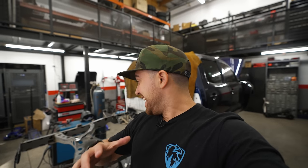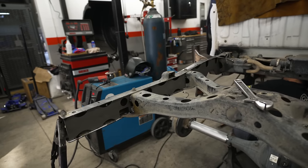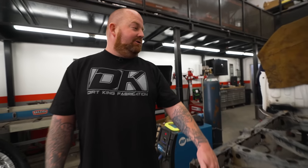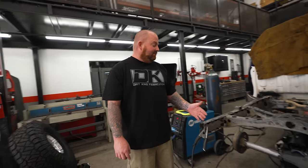While Ian is working on the front of the truck, Taylor's in the back installing the frame plates so Dustin can send it without fearing his chassis is going to bend. From the factory the Tacoma frame is just a C-channel frame. What we do is a full frame plate kit that makes it a boxed frame from basically the cab back - this reinforces the frame itself as well as prevents frame flex.